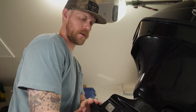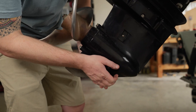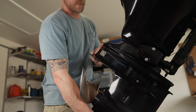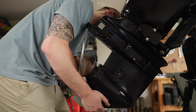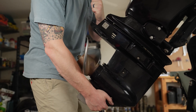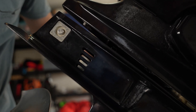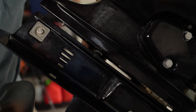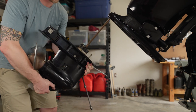Now we've got three out. We left one in place so that the lower unit doesn't drop out immediately, and this gives us a chance to hold on to the lower unit while we loosen that last one. With salt water sometimes it can get a little sticky, so you can take a flat head and just pry it loose. And that's your lower unit.